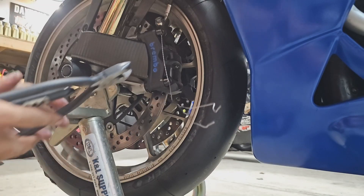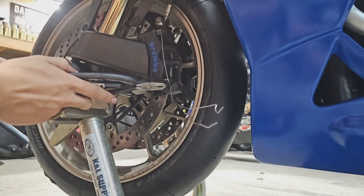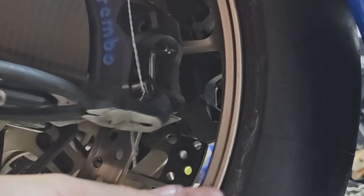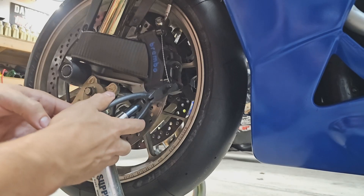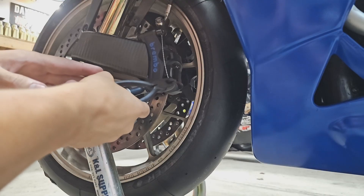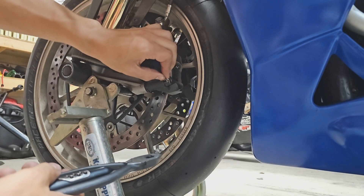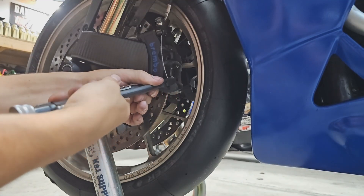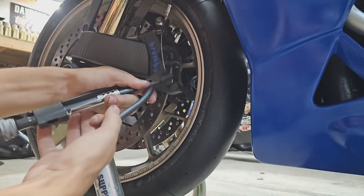Then you're going to cut. I usually take my pliers, go one length of plier, mark it in my head, and go another out — so about an inch out, just over — and then cut it. So then I have that little tail. And with that tail, I'm just going to take our pliers, clamp it, and fold that tail back in. The purpose of folding the tail back in on itself is so that you don't cut yourself when you're down here putting your tire warmers on or whatever else. You just want that tail tucked in up against where it can't scratch you.